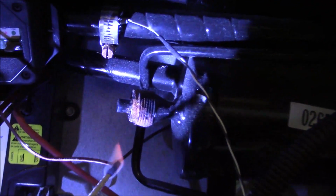This is a Montana. This refrigerator, so you see all these wires here. Obviously, someone has replaced this cooling unit right here. And you can see there's yellowing in there, and there's a valve right here. So we want to see if that thing is leaking. So the way to do that is you take a sulfur stick, and you heat up the sulfur stick, like right here, and you'll see the white smoke coming out of this valve, which means this thing is leaking.